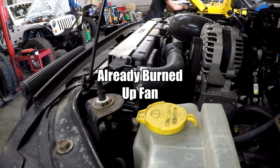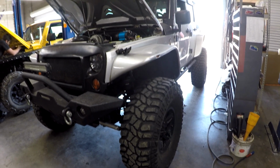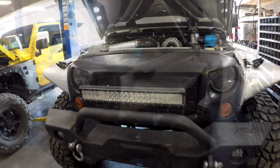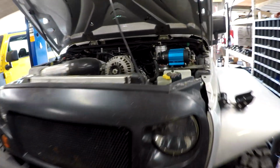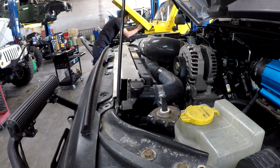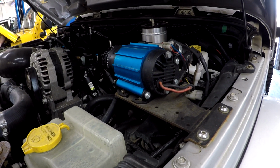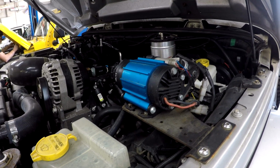Now I can tell you right now, it is hot out there, and we got some big tires on this thing. This is going to overheat going up the pass. I can tell you that without much reservation. Even if we opened up this grill and removed this light bar, we just don't have enough cooling capacity in this, and really nothing is off-boarded. There is no off-board coolers on this. So we're gonna try it. We're gonna see how it works. Now, I can tell you out here in Vegas, we've measured underhood temps in excess of 300 degrees. I've seen the plastic melt under these engine compartments.